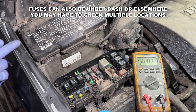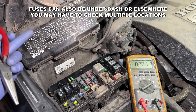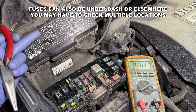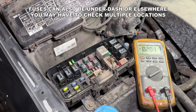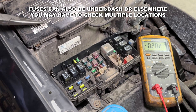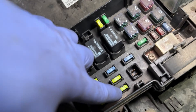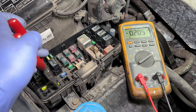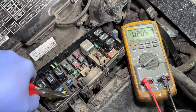When doing this type of testing, you want to start by looking at your fuse box and removing fuses one at a time to see if the number drops. I went ahead and did that, and I actually kind of knew that the radio is one of the common things that causes this on these cars, so I'm going to pull this 20-amp fuse right there.